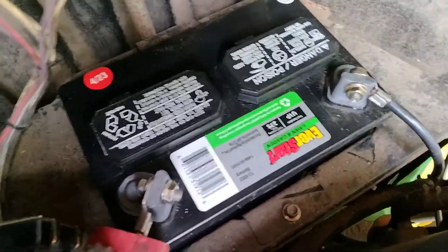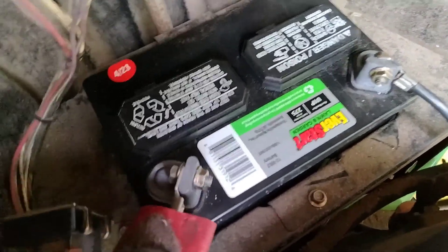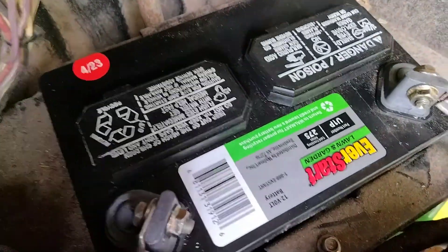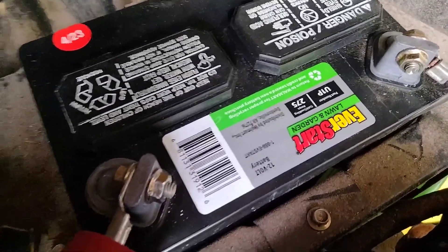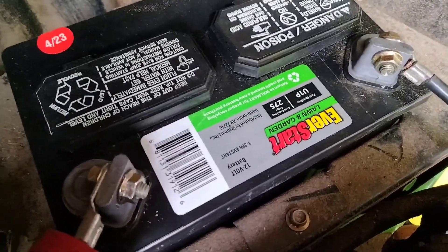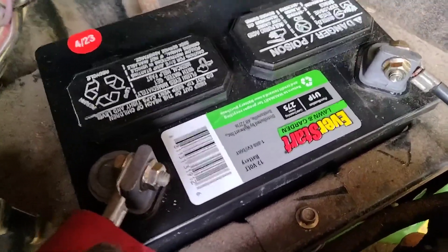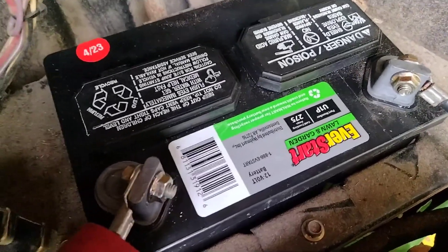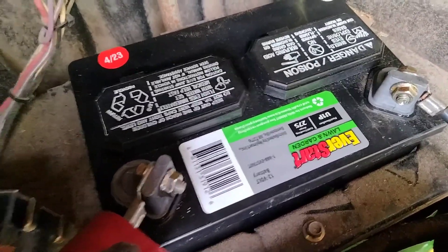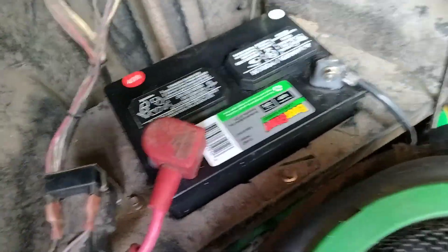You can see that I have connected the terminals very tight — not too tight, because this battery is going to have to be replaced at another occasion down the road. This is a 275 CCA, but now with the battery warmer that I'm about to order — I had one before and it does work — I'm thinking I could get five years out of this battery. With the 275 and wintertime, it gets cold here in the southeast of America, and that can deaden the battery if it's not warmed or tendered or charged. I usually go through this every year and have to put a battery charger on it. Here's the safety boot for the positive terminal.